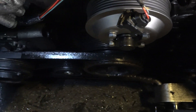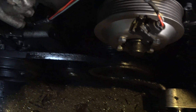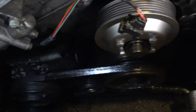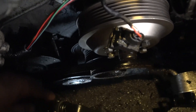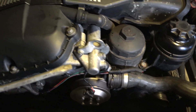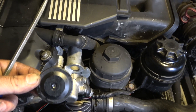That's the AC belt down there — it's a little worn, so I'm going to go ahead and take it off. To take it off, you pretty much have to release it from the tensioner, which is right there. Then you have to take that cover off, and to take the cover off you need a flat-head screwdriver. There's a cover piece down there.